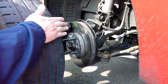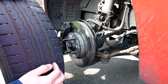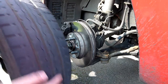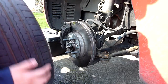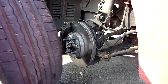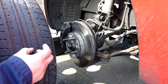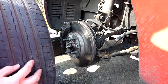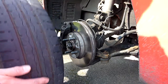I'm also going to check the tire for any uneven wear which would indicate a tracking issue — but it's fine. Whenever you have a tire off, just check that the wear is even, and it is. I do my own tracking and after many months of driving on this setup it looks pretty good. Also look for stones and nails embedded in the tread — poke them out. They may not be causing issues now but later on that nail might puncture the tire as it wears.